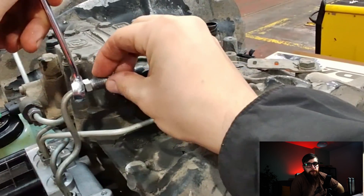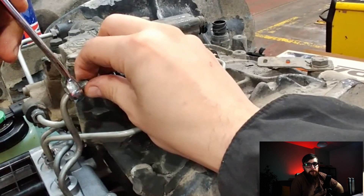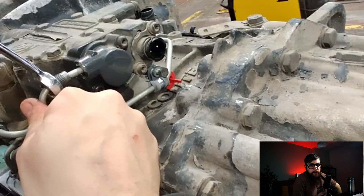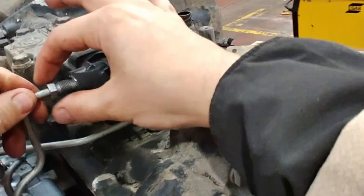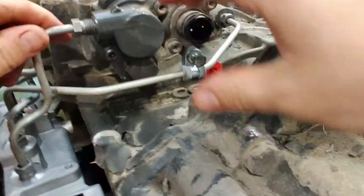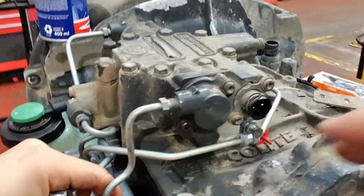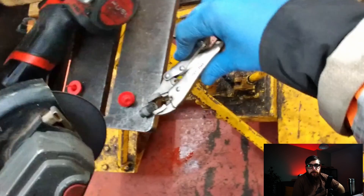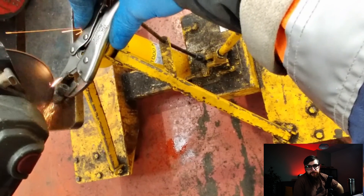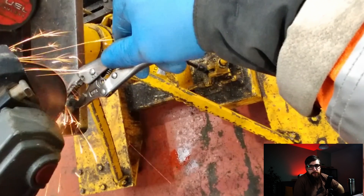With things going too well, it was time for Euro 5 to give me grief yet again. As this pipe didn't seem to line up, I decided to help it along and bend it in, but this also caused me to damage the threads, meaning I couldn't start the union in the alloy housing. Well done, Russell. So I needed a tap to chase the threads, and I still had an old pipe, so time for some fabrication. With some grooves cut in the union with my grinder and a bit of lube, I could run this in by hand and salvage the job.